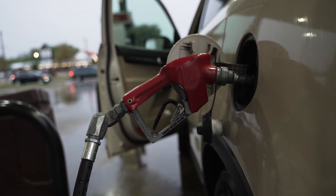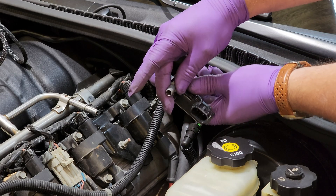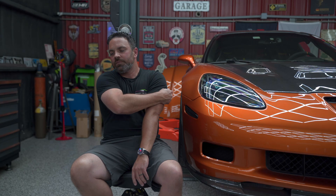Could you dive into the difference between pump E85 and barrel E85? If you're gonna do an E85 tune you should really just run your car on barrel E85. If someone's selling an E85 tune, they're probably gonna tune it for some lower blend closer to 70 percent, because at the pump the ethanol varies between 51 and 83 percent. That's really why our company exists — you're not getting one fuel, you're getting any number of blends.